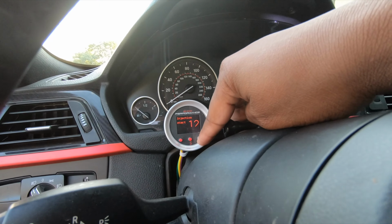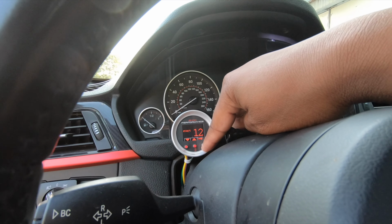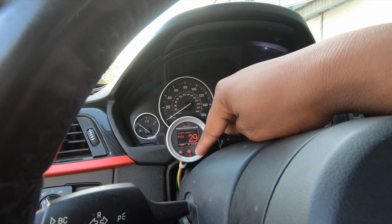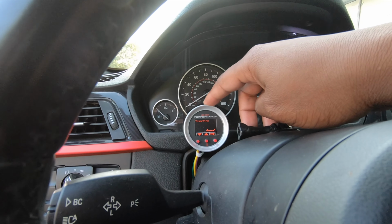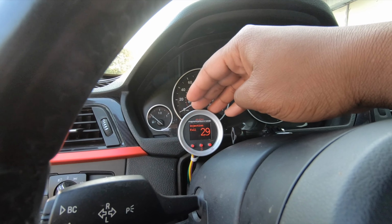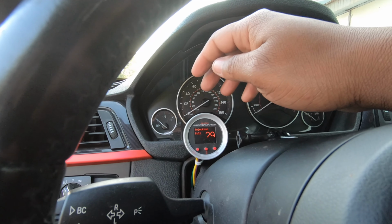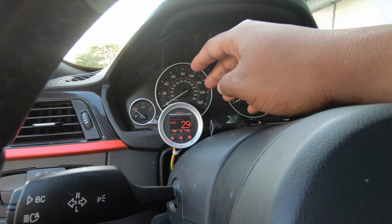This is what I have my car set to for starting injection. So it is progressive. By it being progressive, it starts at a very low pulse, 12 psi, and then full injection is at 29 psi. My car is not tuned to 29 psi, but some of the things we were finding was that at full spray, the car was kind of bogging out a little bit. It was messing around with the fuel trims a lot.